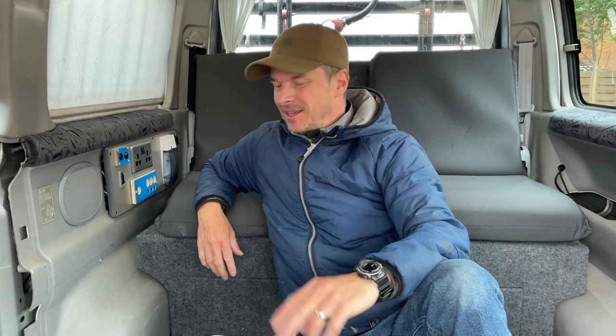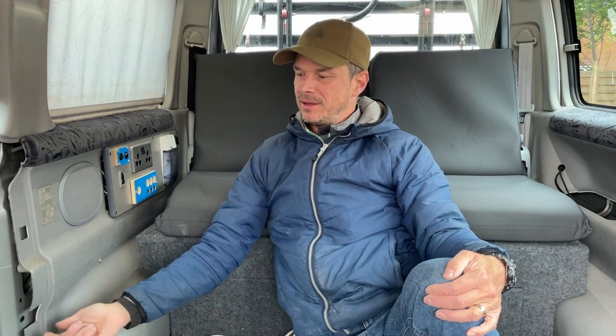Hello and welcome to another video. In this video I'm going to take out my rear heater and aircon system - it doesn't work, as I said in the last video, it's never worked since I bought the van. The heater matrix actually packed up quite early in the van ownership because I had a coolant leak, which is quite a common one on these vehicles. You can just literally bypass those two pipes with a straight-through connection - that solves the problem, you don't get any heat in the back but it's not a big issue. I'm going to remove it today to free up space for maybe a diesel heater and storage.